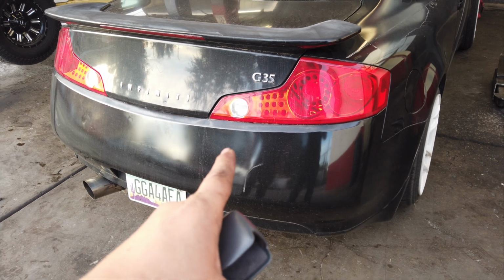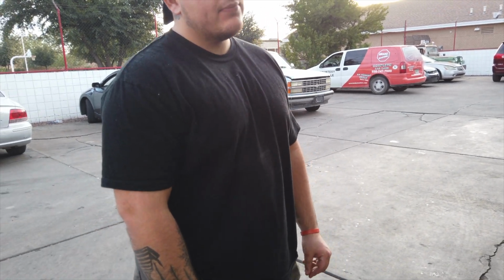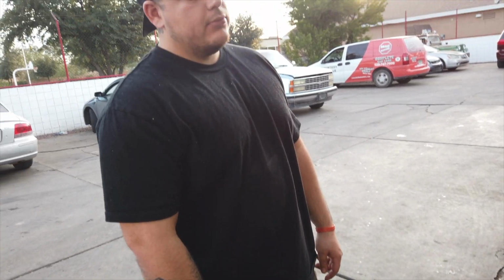Random video today. Random vlog. We're working on the cars. A little maintenance, much needed. Did the spark plugs on the G35, and an oil change. She's idling better, running better. You guys saw how bad the spark plugs were. Took out the injectors off of the Mustang, sent those out to get cleaned, possibly rebuilt.